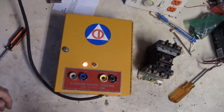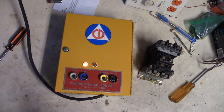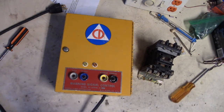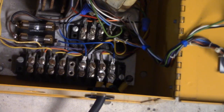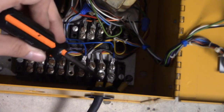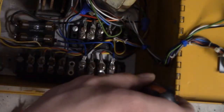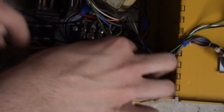That's wiring up an AR timer to power. Now I'm also going to wire it up to a motor starter. For wiring the AR timer to a motor starter, make sure you disconnect power first - always keep it unplugged whenever you're working on it. You're going to need a jumper wire, 16 or 18 gauge. Go ahead and open the timer back up and zoom in - you can see the whole bus bar now. Connect your jumper wire to whichever screw is live; in my case that's screw 9, though your live could be on screw 8. Loosen screw 9 enough to slide your jumper wire in.